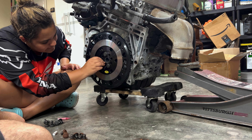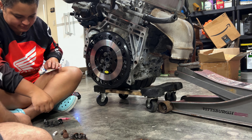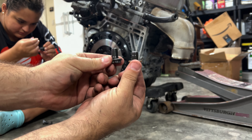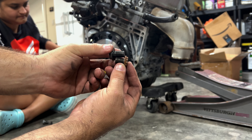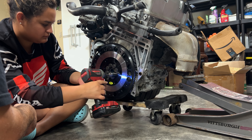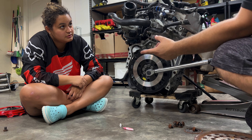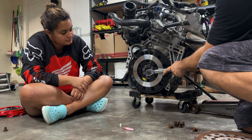K-Series automatic bolts and manual bolts are different. This is an automatic bolt and this one is a manual bolt - as you can see the depth is different. With a flex plate you need a short bolt; with a flywheel you need a longer bolt. This is 45 foot-pounds. The impact already got it to 45 foot-pounds - so that's perfect. Since this is the first step, we have to do everything in equal crisscross. That was 45, now we're going to go to 60.